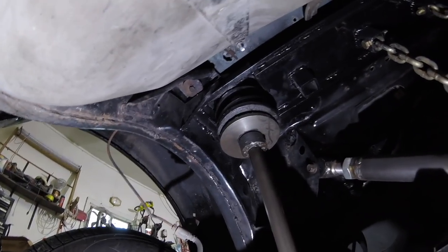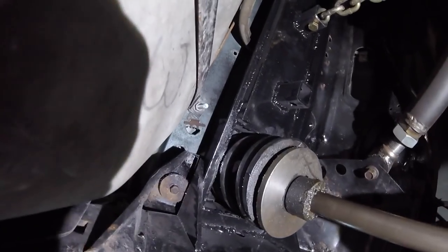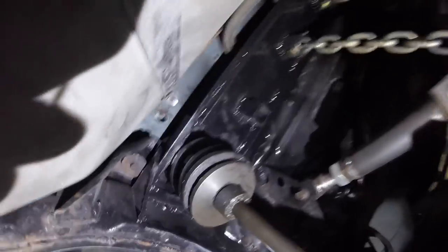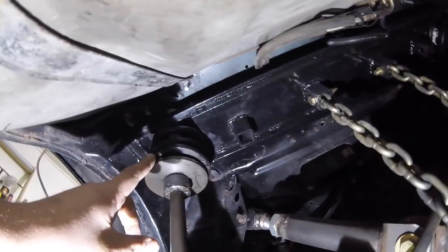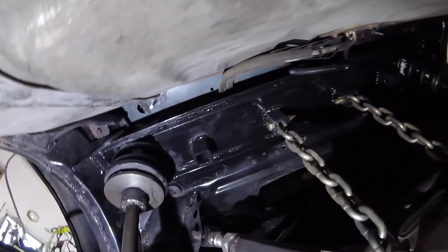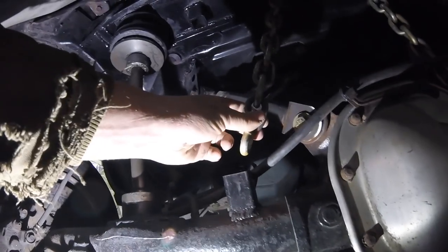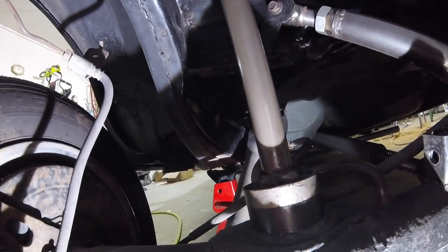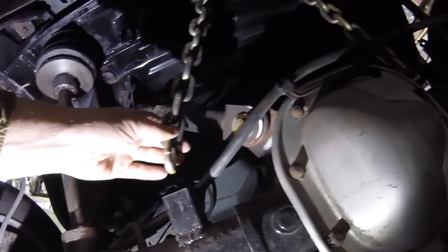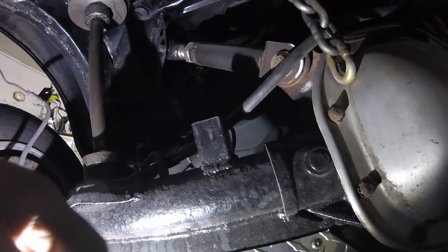Here we are looking at a rare look underneath of the tickler mobile. You can see there's not much spring there, sticking through like there is on the other side, because part of that spring is actually on the other side of the chain bridge, which is super neat. You can see how I ran my chains — that's the distance there. My car is fully locked up right now. It's on jack stands, so I will not die. I can lift the car up, put the jack stands under and drop it, and this is how high it sits. You can see the chains do limit my lockup quite a bit — you lose four or five inches out of your lockup. But they're kind of a necessity, at least for me.